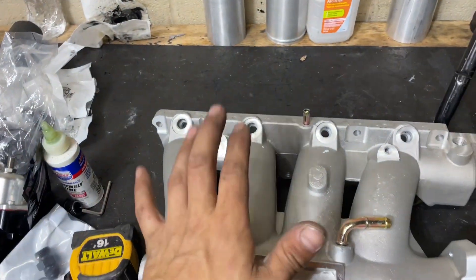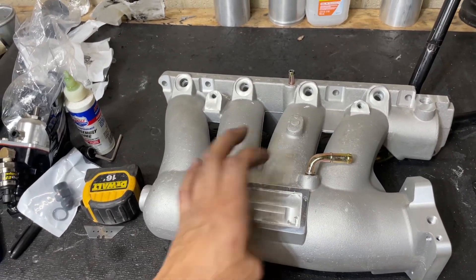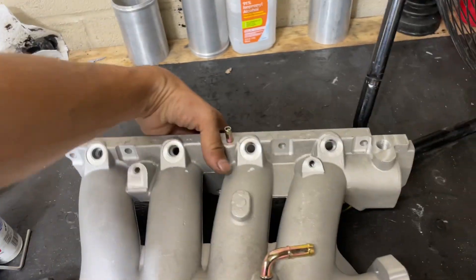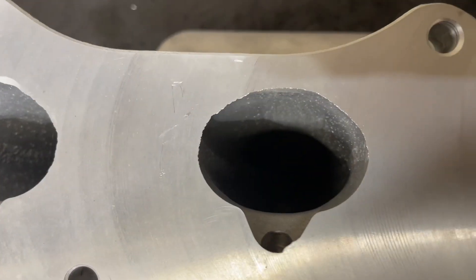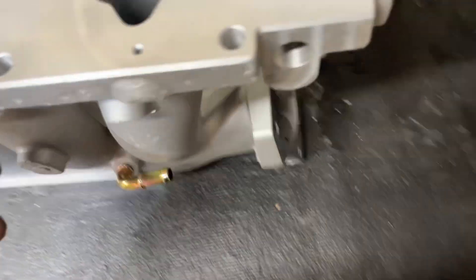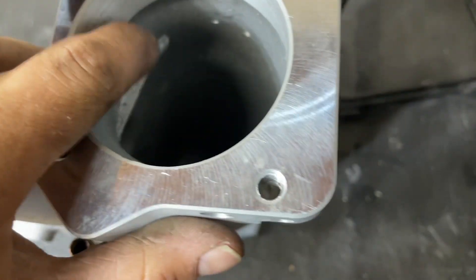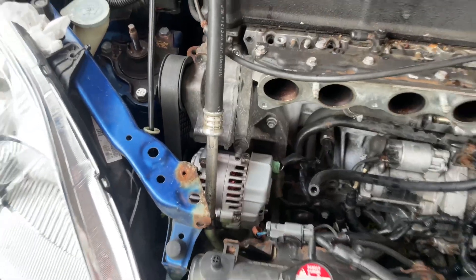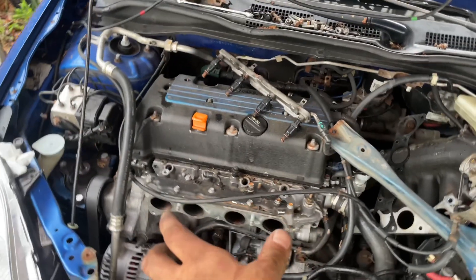I do have this intake manifold for it — this is the cheapest intake manifold you could get on eBay or anywhere for a K24. It still has the fitting here so you don't have to use a block-off plate. But look how bad it is — it needs to be ported so bad. They give you a lot of meat to play with. At least they matched it right here, but look at that lip right there. So much potential. Scratch that idea though — you can't get this piece off without taking off the water pump housing, and we're not draining all the coolant. It hits right here, so the intake manifold must have gone on first, then the water pump.